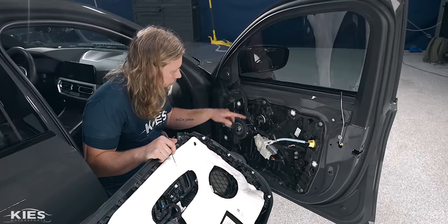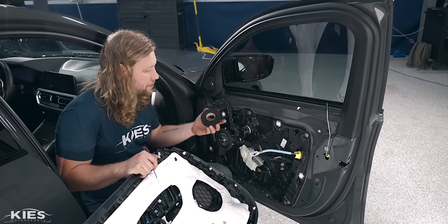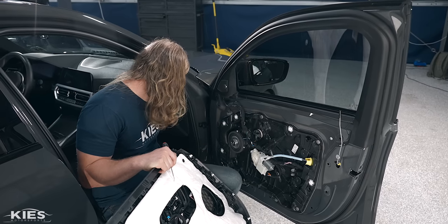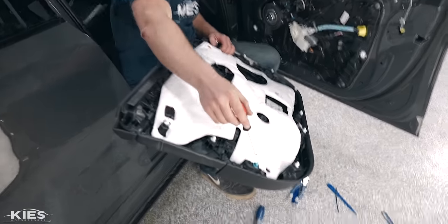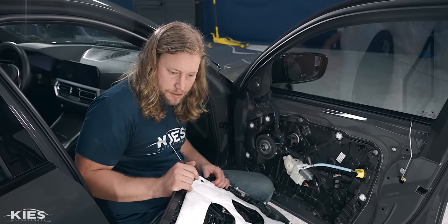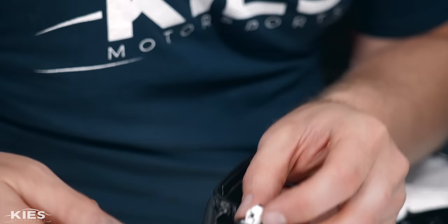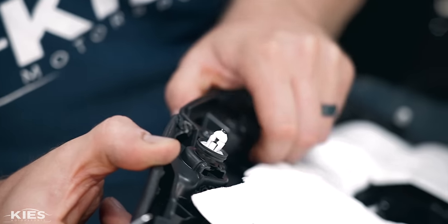I routed everything up, cleaned it up, and in spots where there was a hard plastic connector I like to use Tesa tape — it's basically wire loom tape, very similar to what BMW actually uses, maybe even the same stuff. Now with that we're ready to put the door panel back on. Looking at the clips: if you've done this on an F-series you'll be familiar with them. BMW now has these self-locking tabs on the G-series. If a clip busts apart, just take a screwdriver and put the little hat piece back on, otherwise it's not going to seat correctly.